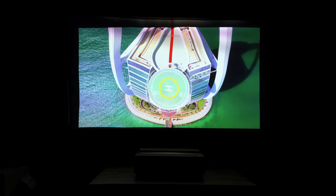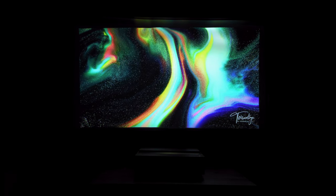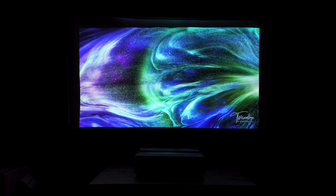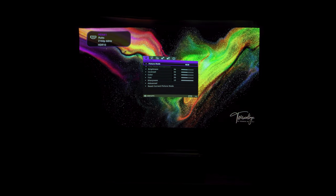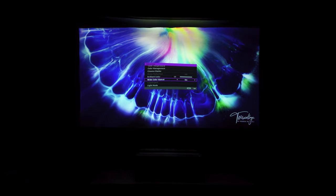Colors are even richer in HDR, and the other thing I noticed was astonishingly clear motion clarity. Watching 60fps HDR footage feels somewhat surreal, and as far as projectors are concerned, it's great to see that there's really no color strobing to the naked eye. One of the great features of the V7050i is the HDR Pro tone mapping, which is handled automatically based on the mode you're in. When viewing HDR content, simply enable wide color gamut support, and the projector will map the tones of the content so that highlights are never blown out and shadows aren't lost. To really take advantage of this, you have to leave filmmaker mode while playing an HDR source — switch over to HDR10 as the picture mode and turn on wide color gamut. This allows the projector to dynamically scale its iris and better preserve colors and details along the brightness range.